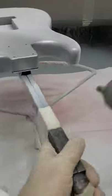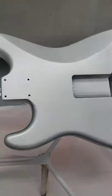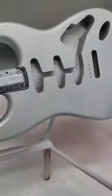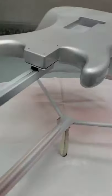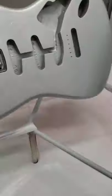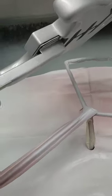Remember that last one, the silver — I went a little crazy. I'm going to lighten up on this one, even though there's no binding. This is not a sparkle, this is a sapphire blue metallic — another more difficult one to do. Because first you put this silver on here like this, you've got to make it perfect. And then you put on there the transparent sapphire blue. So what I'll do is just get it covered — it might be blotchy or uneven looking but it doesn't matter at this point. Get it covered, and then after it dries good I'll inspect it.